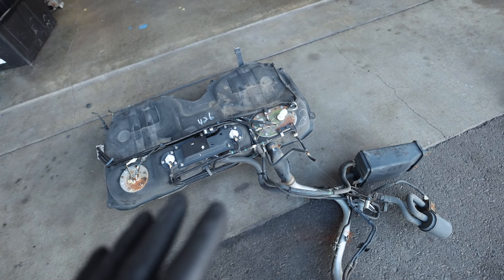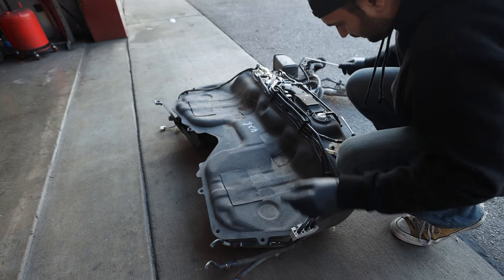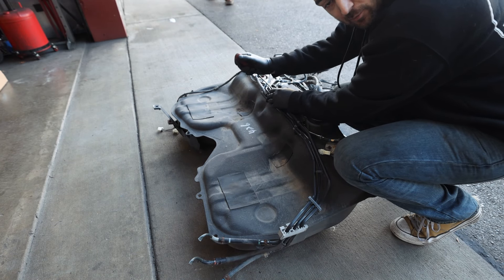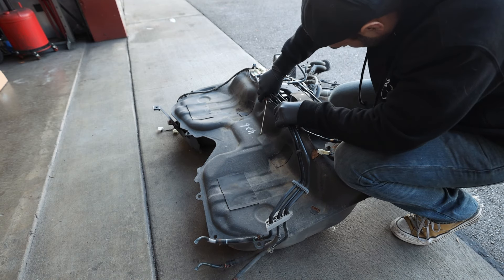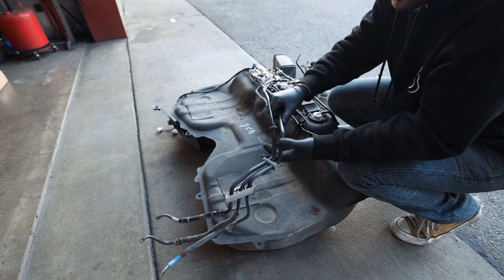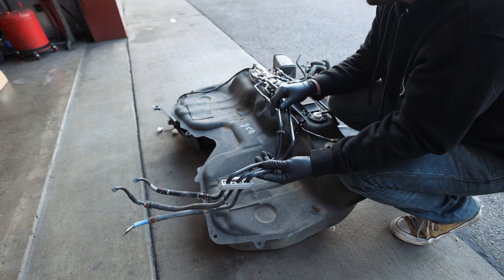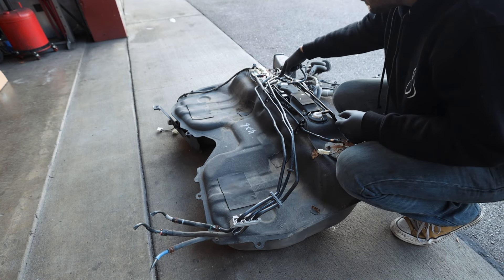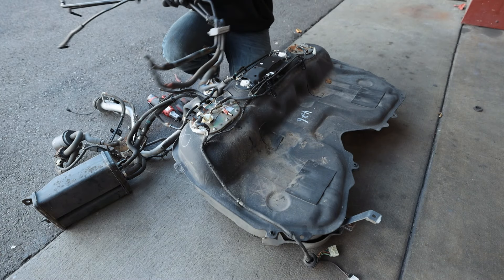I took a whole bunch of photos so we should be able to remember where it all goes. For those that are curious, this is what I've been using for a lot of the smaller stuff — it's just 3M rubberized undercoat, you can pick this up at any auto parts store. Nate came through and brought us more sound deadening — he went straight to Russia to get that stuff. We got these three lines loose. One of these just looks like EVAP from the charcoal canister — that's the blue hard line that feeds all the fuel vapor back into your engine. The other two are feed and return. The hanger's not going back in since we're putting a radium one in here.